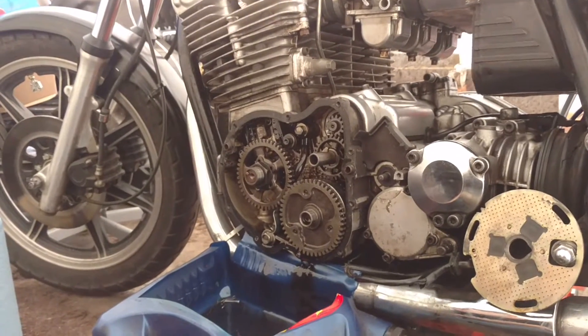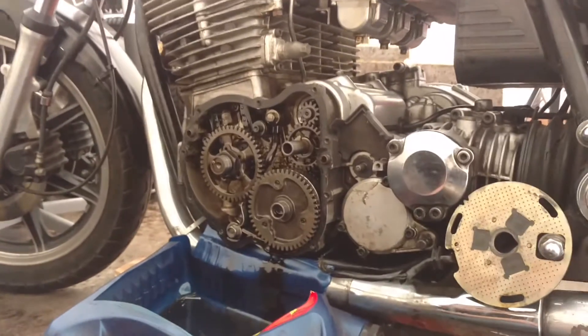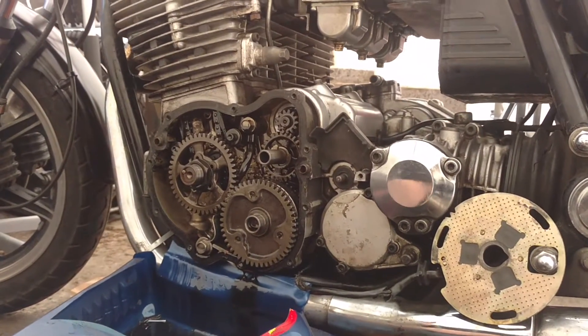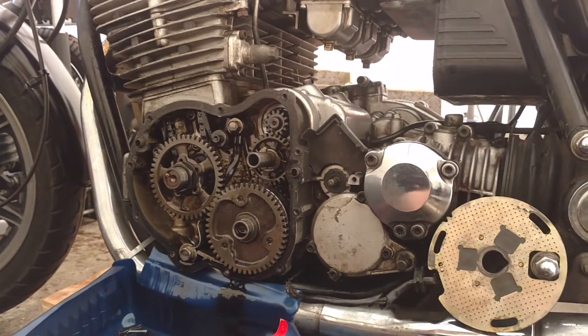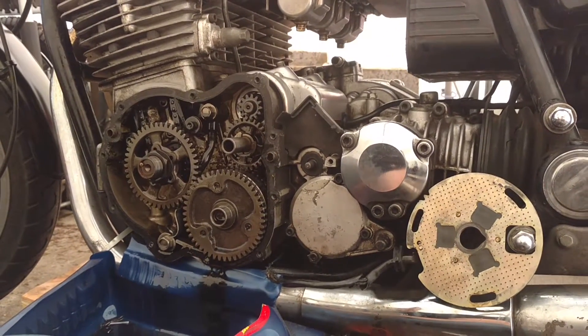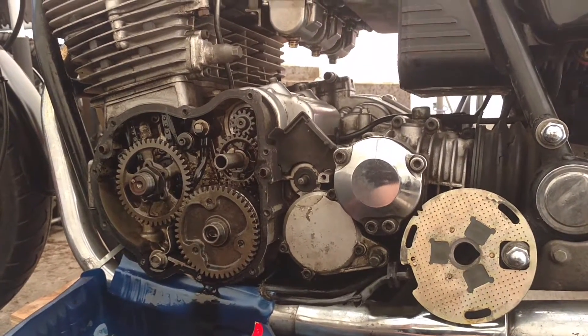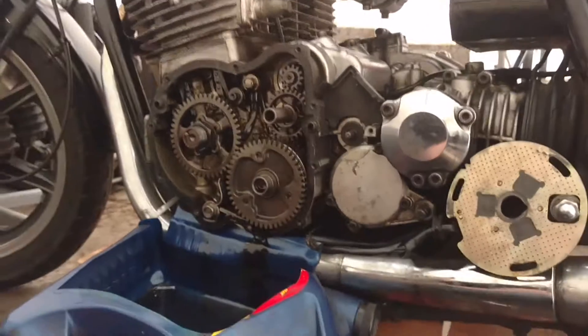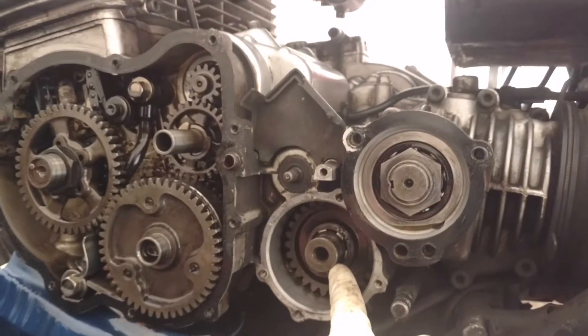This 750 triple got the second gear issue, so I went ahead and pulled the front cover off — all the easy stuff. But we're gonna start digging into the transmission to work on the second gear dogs. Pulling out that shim, we'll take a couple clips and then I'll smash them all together later. These two covers off.